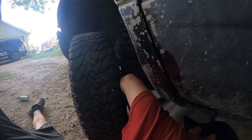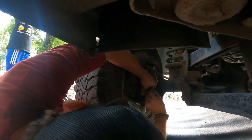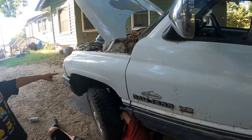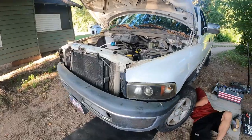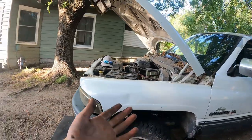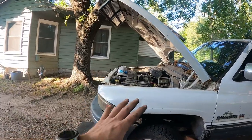Now we turn the steering wheel to get access and we're getting this last bolt in here, and then we'll be done. That's how easy this is. If you're replacing the hub, you could also easily do the same process — just remove the hub, put the new one on, and then put the bolts in. That's the extra step for removing your actual hub if you're replacing that. Not too bad, pretty simple.